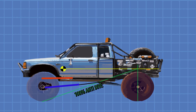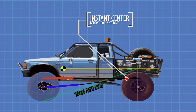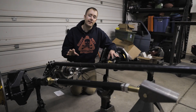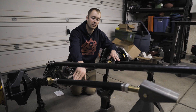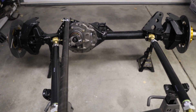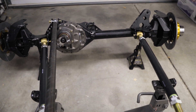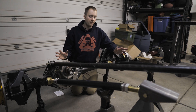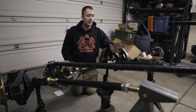What anti-dive value should you build your suspension to? Well, there is no perfect suspension to build — it's going to vary by driver and terrain. A three-link suspension has two lower links, one upper link, and a panhard up front. I don't have the panhard in my mock-up right now but we will talk more about that later.